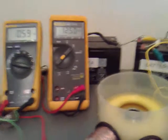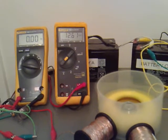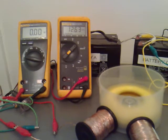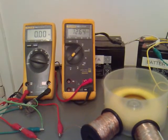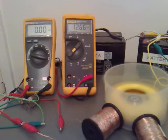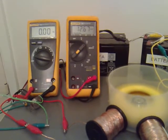Let's see what it's like when it spins down, so I'll take the power off. There's no amps. Coming back up to 12.64, 12.65. So it's getting quite a low volt drop there and quite low amperage as well.